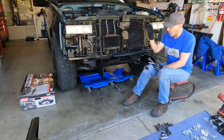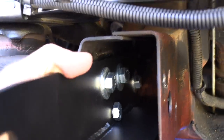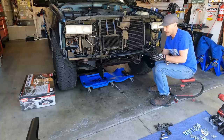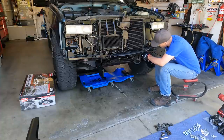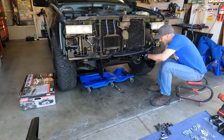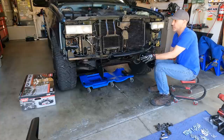Now that we got everything off and a little bit cleaned up, I went ahead and installed the new brackets that come with the new bumper. That's just a matter of putting these four bolts in here. The instructions say that this bolt hole in the very last position — some vehicles don't have it, but this one did. All of them get washers on both sides and lock washers on the nut side. I'm going to go ahead and just tighten this pivot one on the bottom a little bit. You don't want anything tight yet — just get everything snug enough to install but still able to move around, because we're going to adjust the bumper.